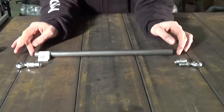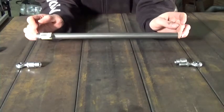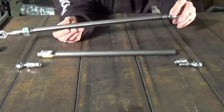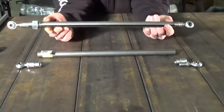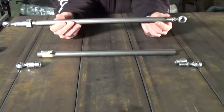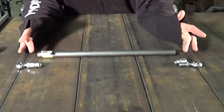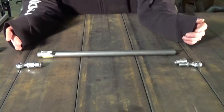And that's really all there is that you need to know to start building your adjustable tie rod: get your eye-to-eye measurement, your hardware will tell you what your tubing length is, and then it's basically just the fabrication work — go cut the stuff, weld it on, and get it thrown on your rig.